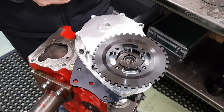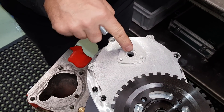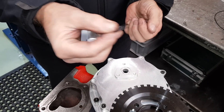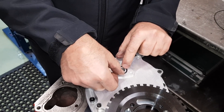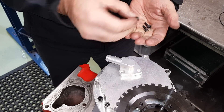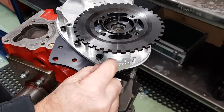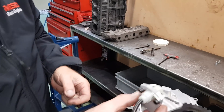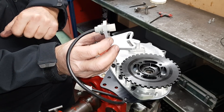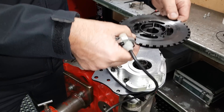Can you fit that with a standard crank damper? Yes, standard crank damper will fit on this. To get a pipe onto here, we've made this fitting. O-ring — always put a bit of grease on — pops into there. This one goes on top with three little screws. We've put an extra boss in here with a couple of holes and we've made this little bracket that takes the Magneti Marelli pickup. It's quite a generic sensor — most engine management kits will use that.